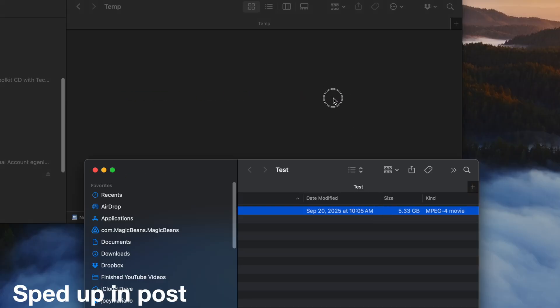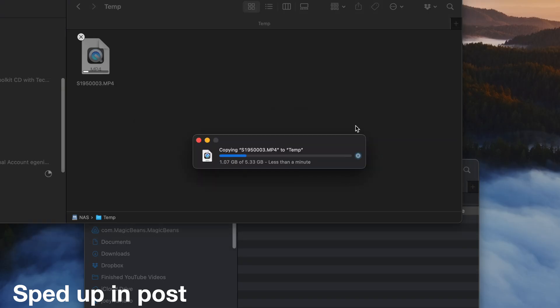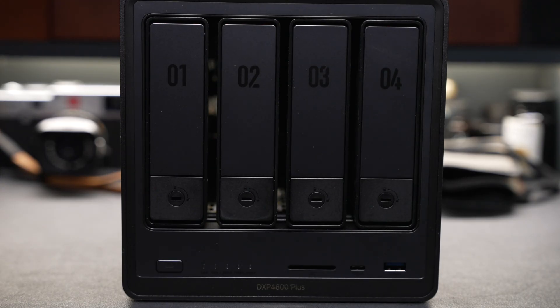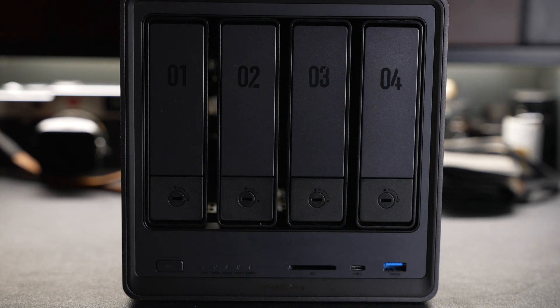So this is a good time to go over my conclusions compared to my Mac mini with external drive setup — this is way better. I just feel more secure with it being always on. There's no lag with the drive spinning up and everything just works flawlessly. I also noticed file transfers are faster — maybe because of the four-bay RAID array. Here I'm transferring a five gigabyte file and it takes less than a minute, which is faster than before. The bottleneck in my system is that I'm still using a one gigabit ethernet switch, but I eventually want to upgrade to 2.5 or 10 gigabit to reach the maximum speed of 1,250 megabytes per second. I also think it looks super cool. The SD card in the front is super handy — I record my kids' soccer games and after I'm done I can just pop the card directly in, transfer the files, and it shows up in Plex. Then my wife and I can watch it on our bedroom TV, and I can even share the videos with teammates who couldn't make the game.